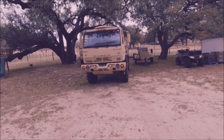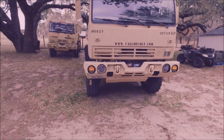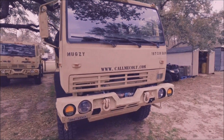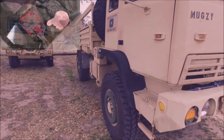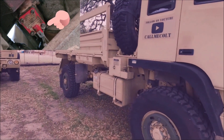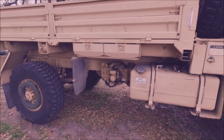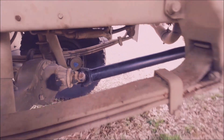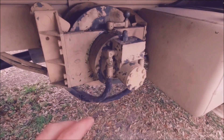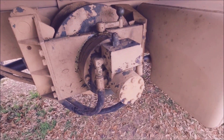Got some hydraulic fluid on the ground. That was because I figured out why the PTO wasn't engaging. The spot I'd picked on the frame to ground on the driver's side of the truck wasn't good. So I moved it to one of the bolts that's actually on the PTO, engaged it, and my wife yelled to me that it started leaking. One of the fittings over at the T started to leak, and then a whole bunch of fluid started coming down on the sides out here.